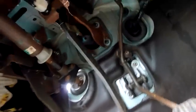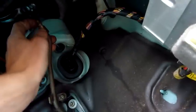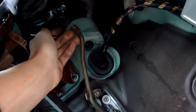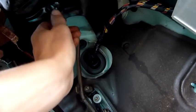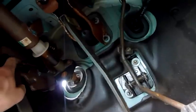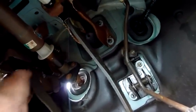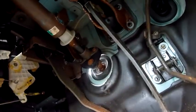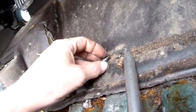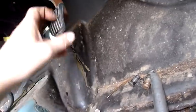The brake pedal's now disconnected from the booster. That's just a cable and return spring. I'll pull it up through the slot — and that's the clutch. Accelerator cable now completely disconnected. I'll pull it back through the firewall. Clutch is the same by the looks of it — spring clip off, push it forward. Now the clutch master cylinder is disconnected. These pins and clips are quite handy too — they're worth keeping if you're not keeping the rest of it. That's all out.